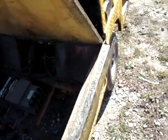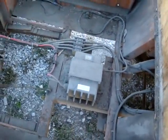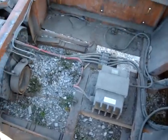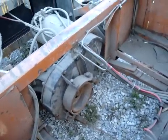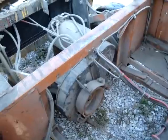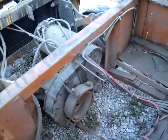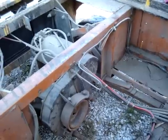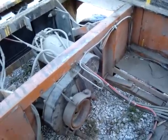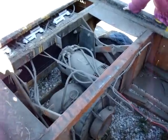Then we get this front lid up. You can tell it has a built-in charger in it which works. When I got it, inside the chain case the sprocket on the motor was toast — it wouldn't move, it looked more like a sprag gear than a sprocket. So I sourced a couple of number 35 sprockets, machined the old teeth off the original sprocket, then slid them on, spaced them, and welded it — instead of spending $50 on a new one from Taylor Dunn. Plus it probably sped it up a little bit and made it faster.